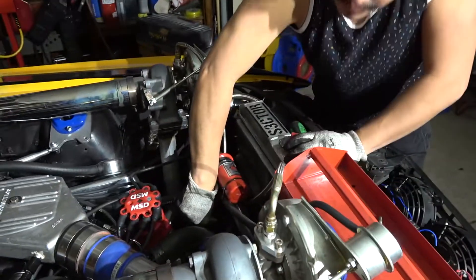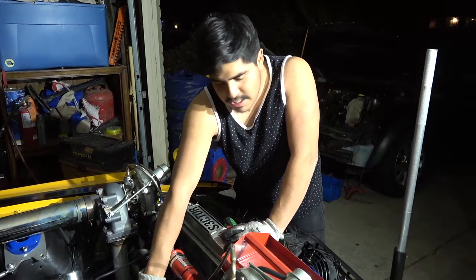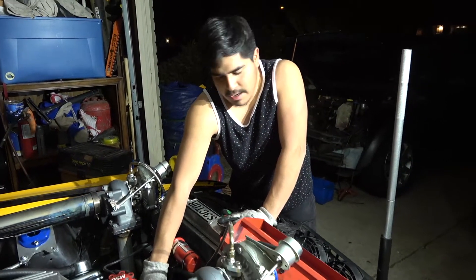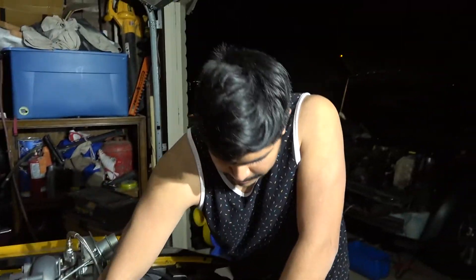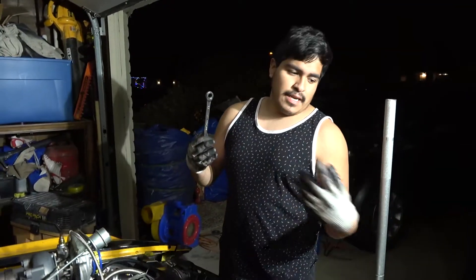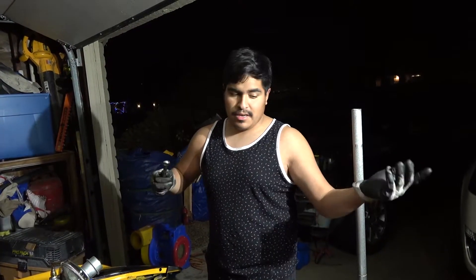If I remove the lower hose and the upper hose and these little hoses, I just noticed that my electric water pump doesn't have them, so I might have to block them off. I'm removing the bolts for the water pump, and once I remove it I'm gonna start installing. I might not finish today — I'll probably just remove it and then next day install the whole thing. But yeah, I'm almost there to take off the mechanical water pump.